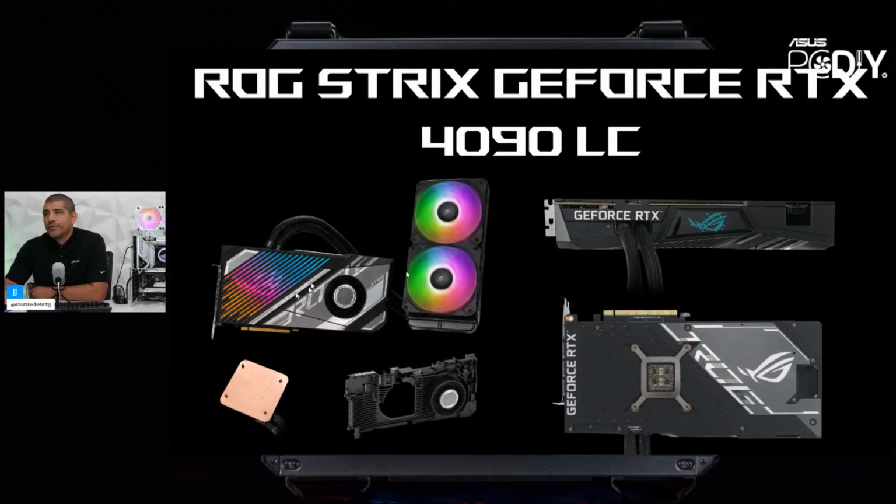Here, you still do have to account for your tubing, and for mounting a 240 millimeter radiator. If your chassis can support dual radiator configurations, then great. This could be a viable option for you. Performance is very good. It's going to be probably a little bit cooler than our ROG STRIX 4090. The ROG STRIX 4090, though, I will say will probably even be quieter, and also probably carry the benefit of slightly lower VRM temperature and memory temperature. But from the overall performance perspective, they're going to be almost at parity, right? And this large base plate makes contact with the GPU and the memory. And then this large assembly right here makes contact with the rest of the PCB and the VRM components.